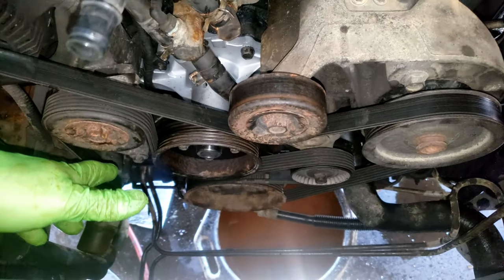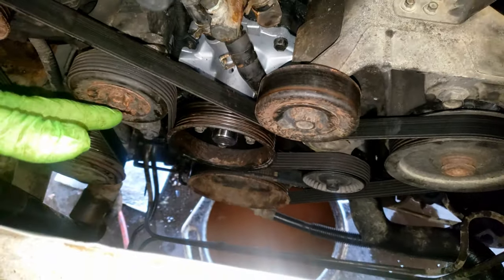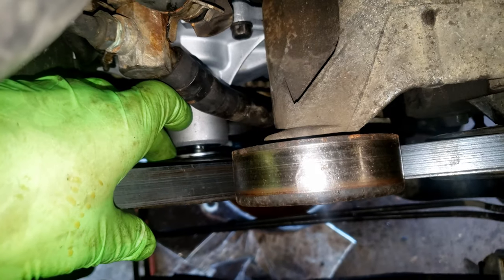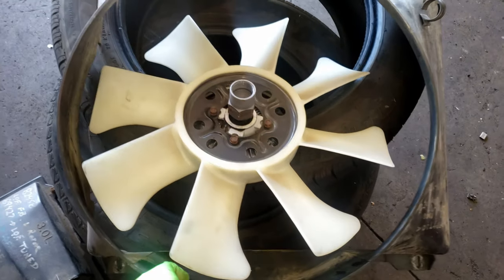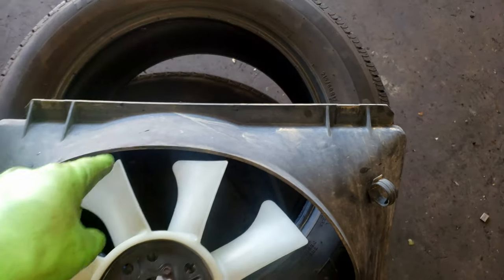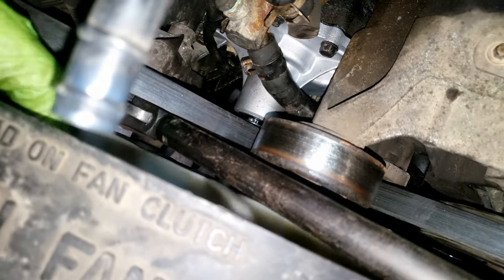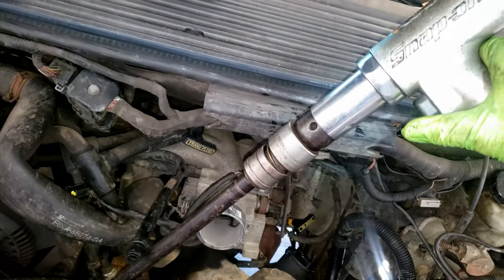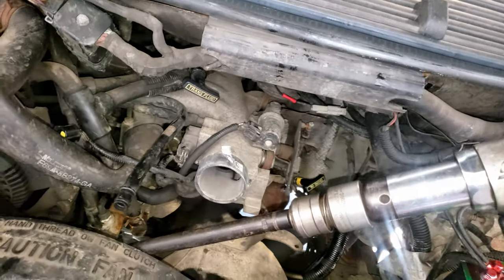Ready to drop the fan and shroud in. Before doing so, make sure you double-check that all your clamps and bolts are tight and belt routing is proper. When putting the pulley back on it wants to freewheel on you, so grab the inside with some large channel lock pliers and torque those down. When dropping the fan in, make sure they go in together like they came out. Once the fan clutch is threaded down, put your fan clutch wrench or this tool back on and give it a few hits with the hammer, and that's going to be tight enough.